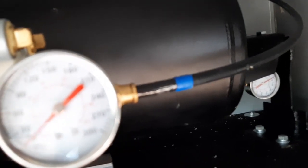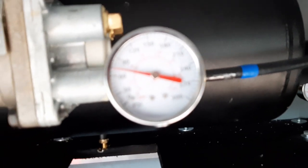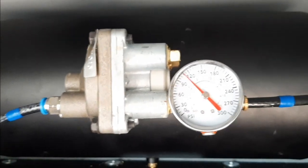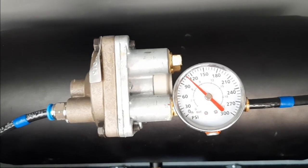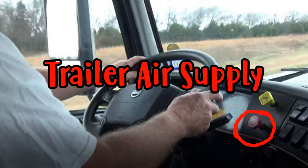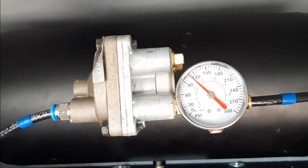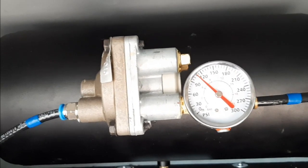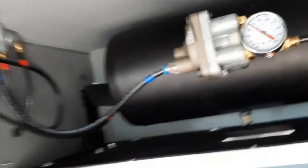Right now I've pulled the red knob out on the dash in the truck, so I can disconnect my lines. What that does is automatically set the brakes. The red knob is to supply air to your trailer — it applies the air pressure to the brakes — so when I disconnect the lines it'll still be pressurized and the brakes will be on in the trailer so I can disconnect without pulling the trailer with me.